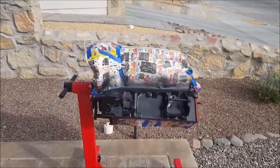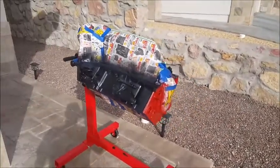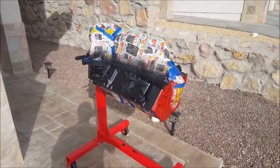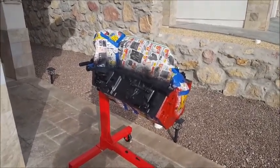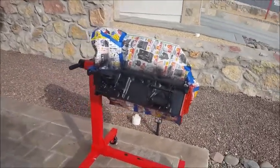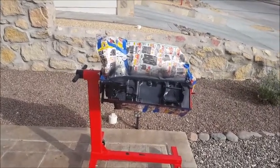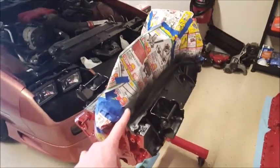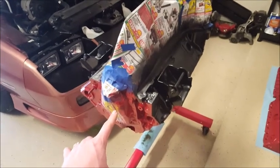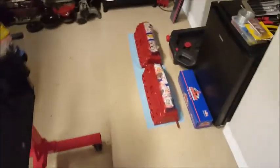If you are painting a block or engine parts, it says to allow seven days before actually running it. In my situation that's not a problem, but if you're doing it while the engine's still in or soon to be in, make sure you just give it time to set. I got the block painted but still haven't untaped it — my next video will cover how to install the oil pan and timing chain cover, so I'm using the tape as a cover for now. I did get the heads done today.